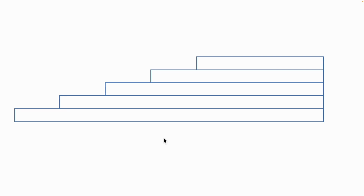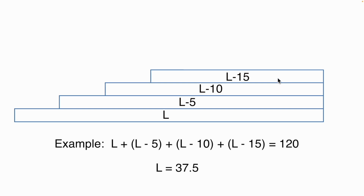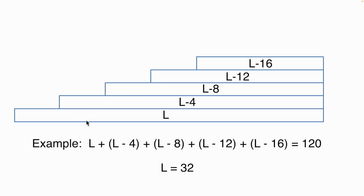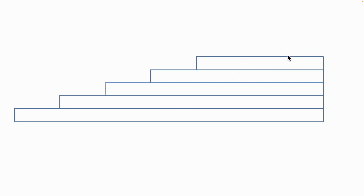You can modify this design in whatever way you want. For example, you can take away the top level. With only 4 levels, you'll have less total lift height, but each level will be a bit wider. Similarly, you could make each step a bit narrower. This will make the ramp steeper, but at the top you'll have a wider platform. It really just depends on your circumstances, what vehicle you're working with, what tire size you have, and how high you want to lift the vehicle.